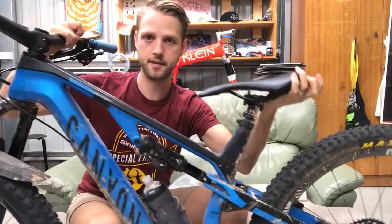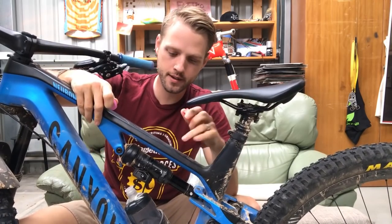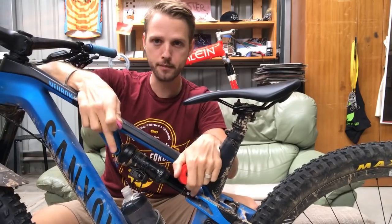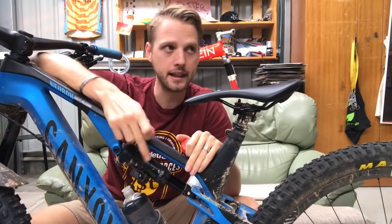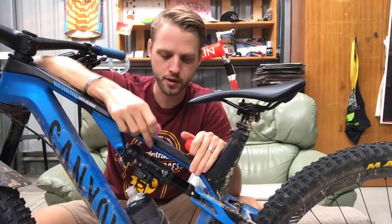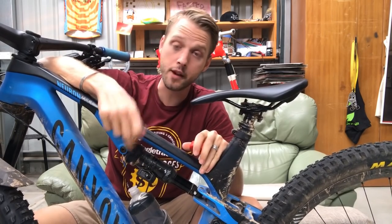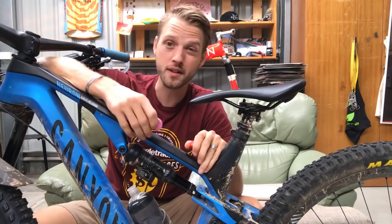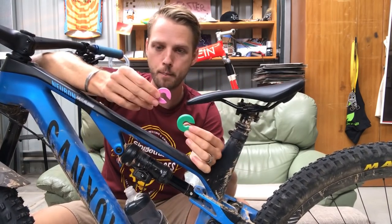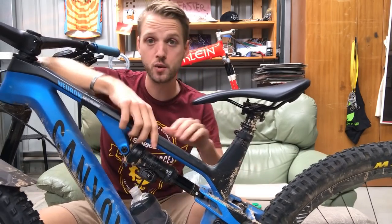Sorry, this is live, so I haven't rehearsed this one. So this is, oh gosh, I'm trying to remember the size. This is 210 millimeters eye to eye, and the stroke length I think is, I want to say 50 millimeters. I've completely had a mind blank on that, but I think it's about 50 millimeters. Anyway, there is a spacer inside this shock, but it is one of the smaller spacers. I think it might actually be this green one or this pink one. I'm not entirely sure.